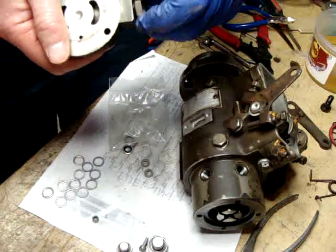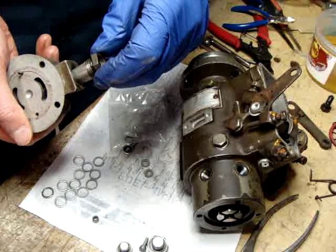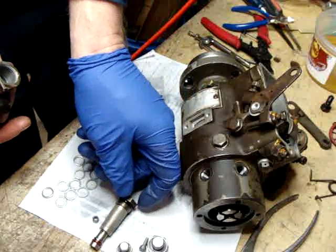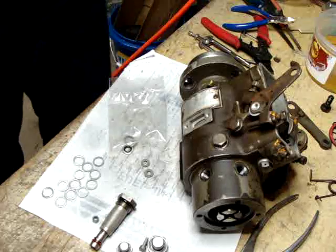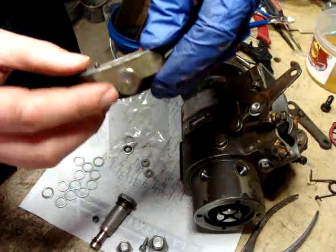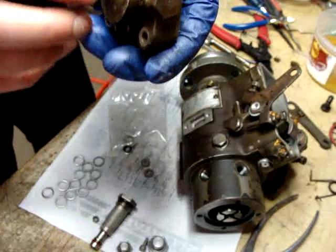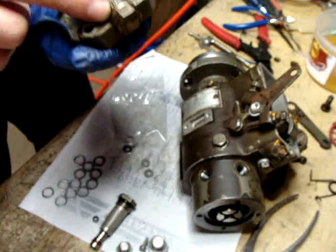That was really tight, but I was able to get it off. There's an O-ring — that's going to account for one more O-ring in the kit we're going to need — and there's another small O-ring down at the bottom. Looking down inside, nothing really, just a couple drops of fuel. We've got this plug on the bottom I've never had off, and that's probably got some sort of seal associated with it. I don't even know if I want to try taking that off — it looks like it hasn't been off in a long, long time. Maybe never.